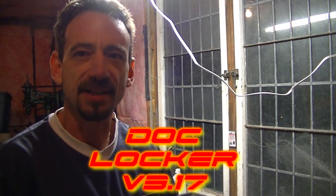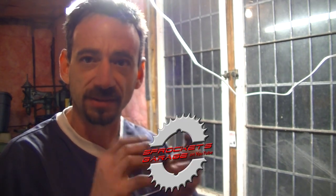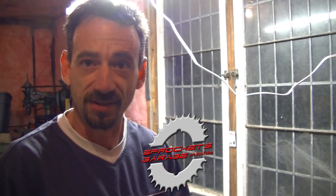When I started shooting this video I had thought that the Peerless 2317 transaxle had the same pin, spider, and side gear arrangement as all the other 2300s. I had figured I was going to do a lock video of a standard 2300, rip it apart, do a quick weld of spiders to pins, slam it back together, and away we go.